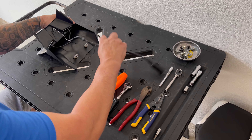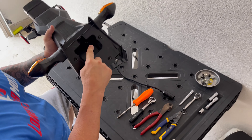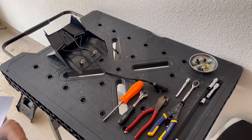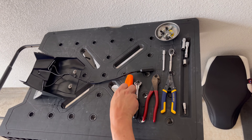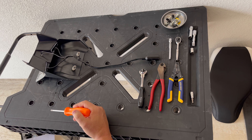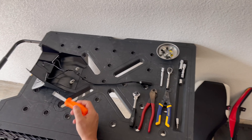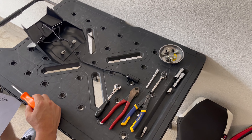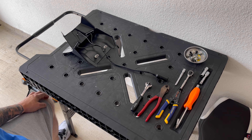I've already taken the liberty of hooking up the wire off our old fender. What you want to do is cut it where it comes out, because you're going to have to use it on the new one. This plug has four wires in it: a green, a blue, an orange, and a yellow. The green is the ground, so it ties into both turn signals and the license plate light — all three tie together. The blue goes to the right turn signal, the orange goes to the left turn signal, and the yellow wire ties into the white on the license plate light. The kit comes with butt splices you can use, or if you have a soldering iron, it's better to just solder them together.